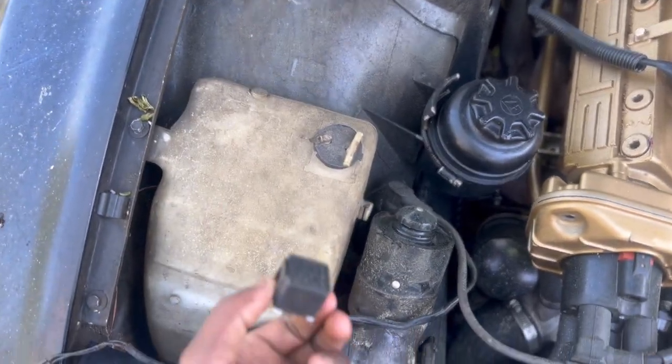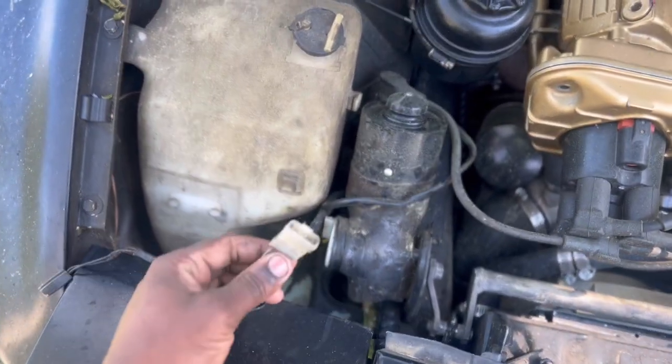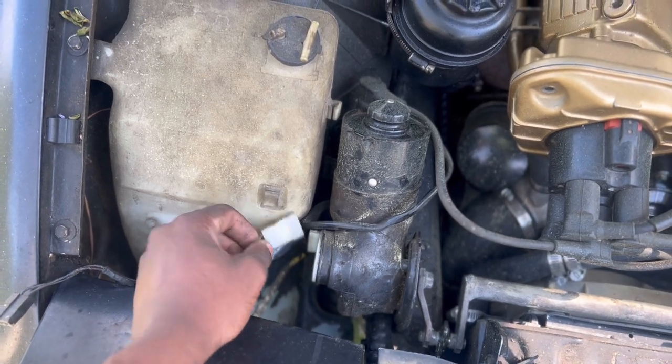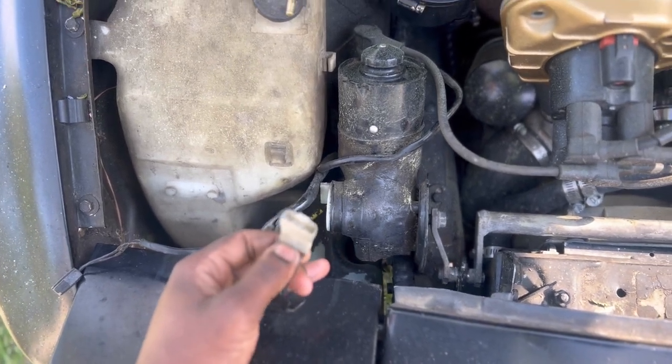Potentially, I have replaced this relay right here, but nothing had happened. And then I just noticed my wire probably was not even connected the whole time. But while we got this unplugged, we might as well go ahead and test this. So I'm going to go get my meter and let's go from there.